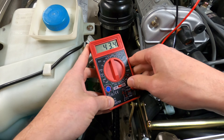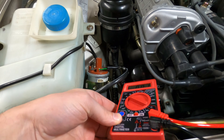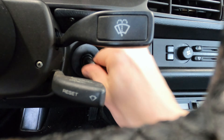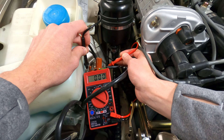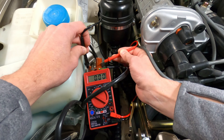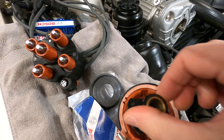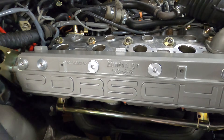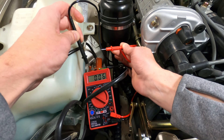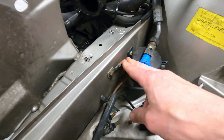It's generally a good idea to first test power in the circuit to rule out any electrical issues prior to replacing a part. The ignition coil is supplied with 12 volts of current from the battery when the ignition switch is turned on. So go ahead and turn the ignition to the on position, set your multimeter to the DC setting, and then touch the probes to the positive terminal and any grounding point on the car. You should also get about 12 volts from the coil's negative terminal to a grounding point, because the ignition rotor isn't actively closing any of the distributor points while the engine isn't running. If you're not getting approximately 12 volts, there's a problem with either the ground or power to the coil, and you'd want to check your grounds and trace the power cable back to the central electrical panel for further inspection.